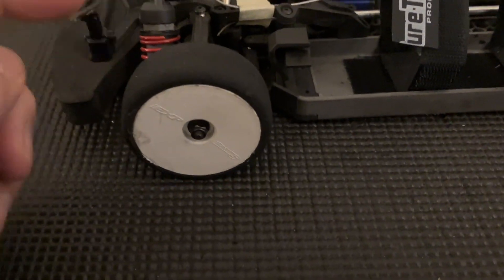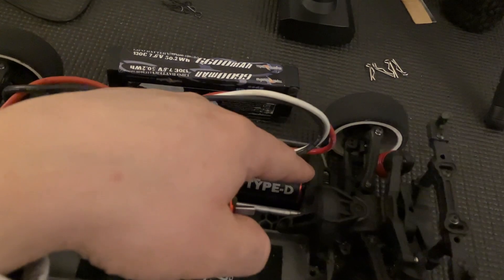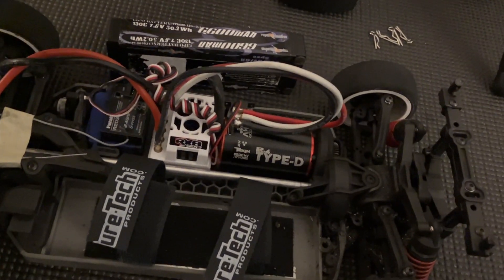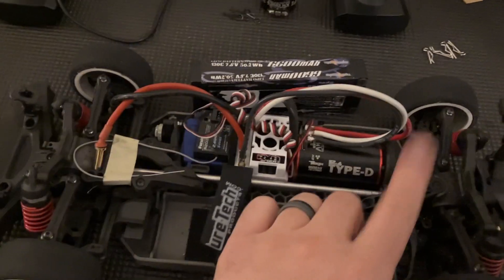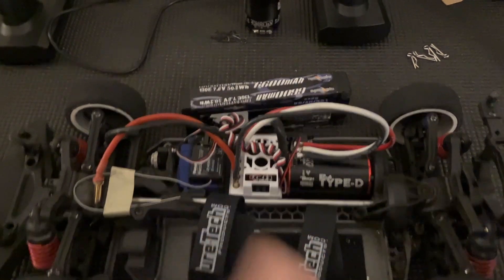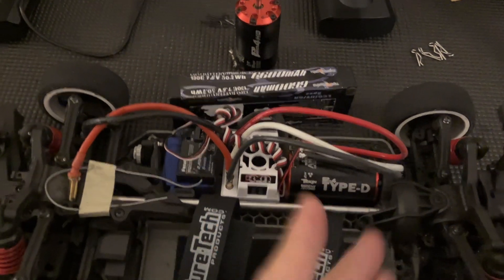Wheels and tires — I'm using Sweeps, the same wheels and tires as the other run. I do have a video doing runs with this motor. That's with the 40-tooth pinion and the 48-tooth spur. That spur is by Hot Racing — make sure you look them up. It's a 48-tooth, 48-pitch made for this vehicle. I'm going to put some links in the description from the original installation, where I had to put some O-rings to keep the spacing correct so it wouldn't shift.